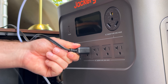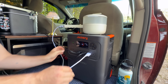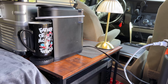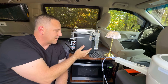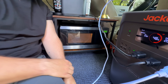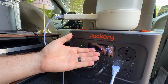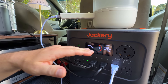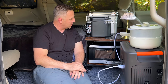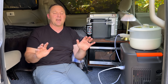I went ahead and primed all these devices with a little bit of water so I don't burn them out. To get this test going, I'll power up the device, start the AC inverter with a simple touch of the button, and crank up the water kettle to its 1500-watt load. To keep the party going, let's get the Keurig running — the power station bumps straight up to about 2000 watts. And then adding the microwave, we're pulling 3200 watts total, which is more than the rated single 2400-watt output but less than the 3600-watt maximum continuous load. Everything is running as designed. The Keurig has finished brewing, we're back down to 2000 watts, and that is an absolute success for the AC inverter.